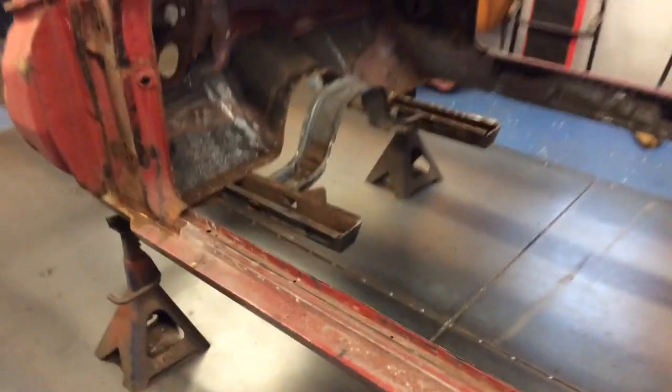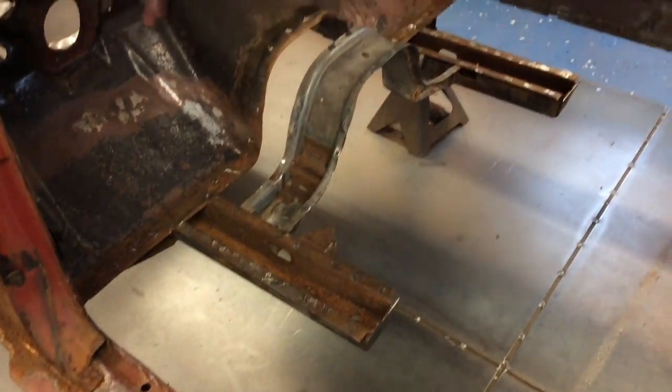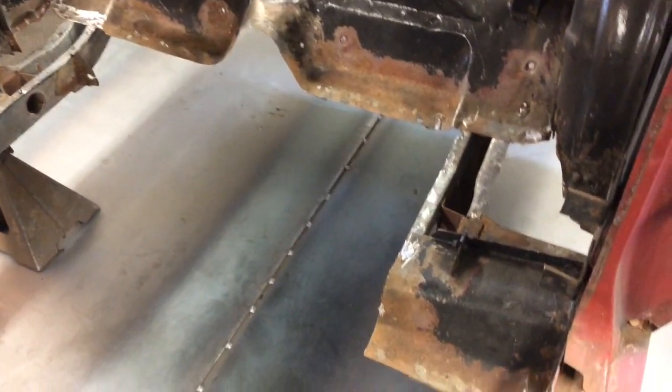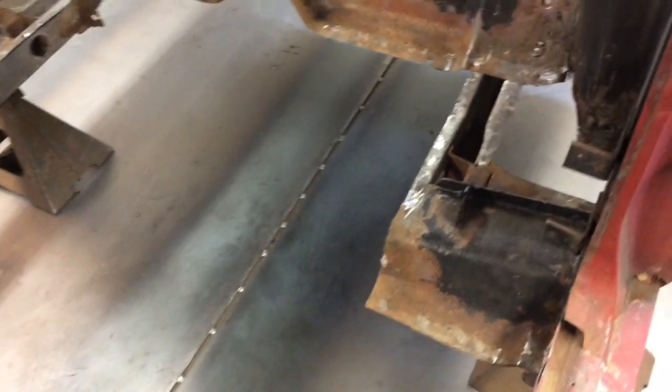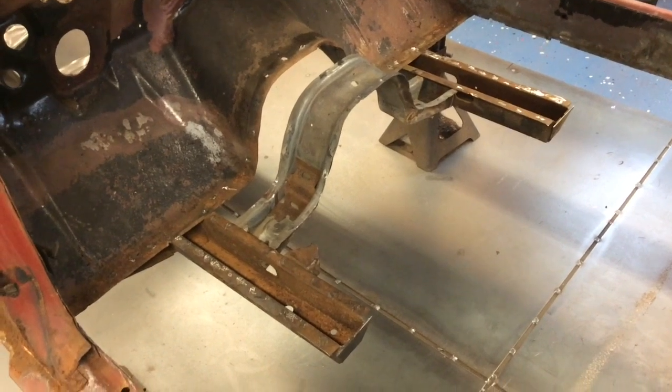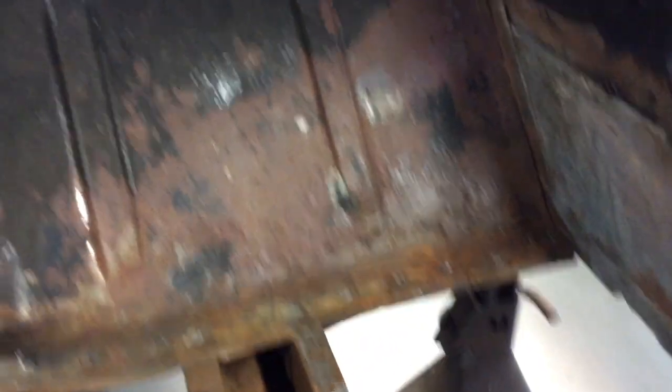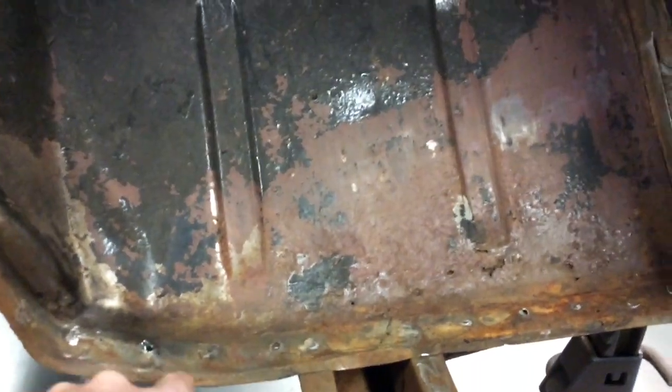Looking up in the car, you can see all the old floor pan I got removed from the entire way around. All the pan's gone. I ground down all the spot welds that were originally there, which you can see. I've got to clean up the metal the whole way around yet to prep all that area for the new floor pan to go in. Let me crawl inside and take a look. You can see the toe board area on this side.